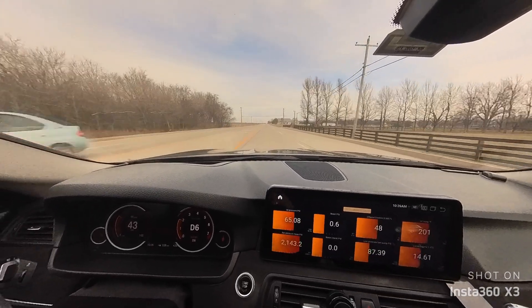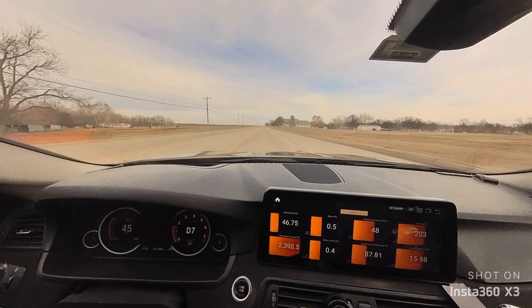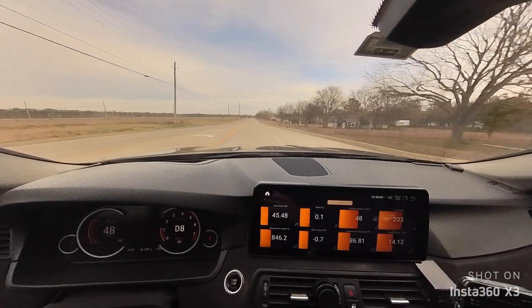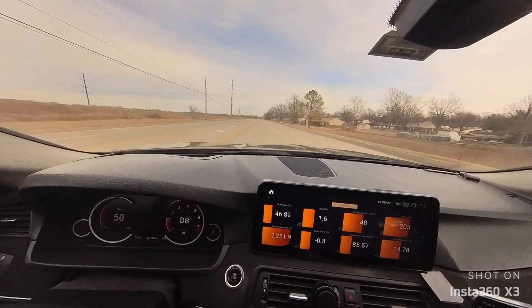Car's driving great. You're not really going to see much difference in driving ability when it comes to installing the 3.5 bar T-MAP sensor in the intake manifold. Again, it is really just a tuning parameter — it helps you with identifying your boost, so I don't expect to see any changes while driving. That's really all I wanted to cover in this video — just a quick overview on how to get this installed and why we actually do the upgrade to the 3.5 T-MAP sensor.